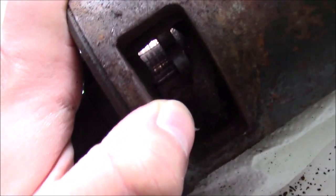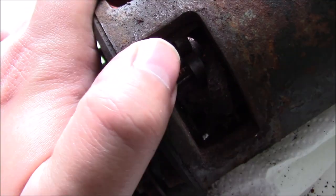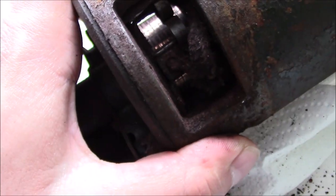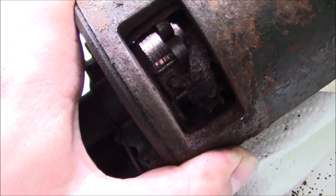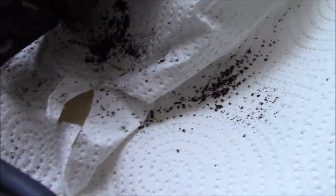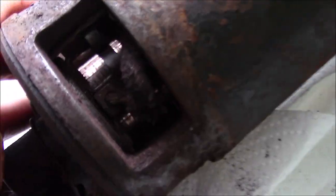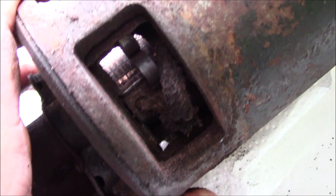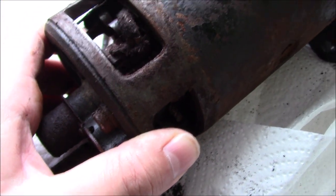And that there is the brush. At the top here is the spring, and the brushes are actually pretty stuck. One of the jobs I do need to do is free those up. I think they're just stuck with dirt. You can see what's coming out - there's all this sort of powdery, graphitey, rusty, flaky stuff that's just been building up in here. And I think this is probably the main problem with the starter - just everything's dirty and stuck. So we'll give that a good clean out.